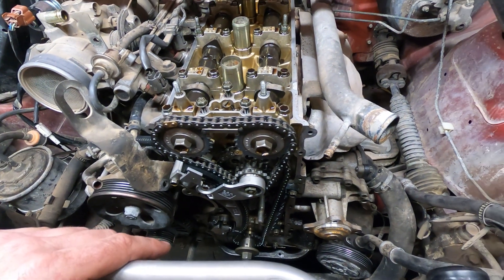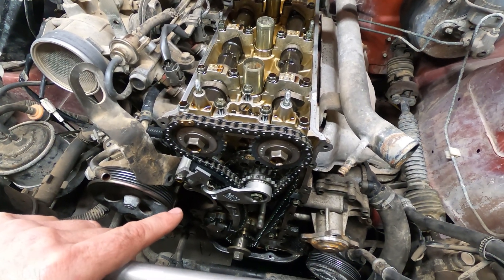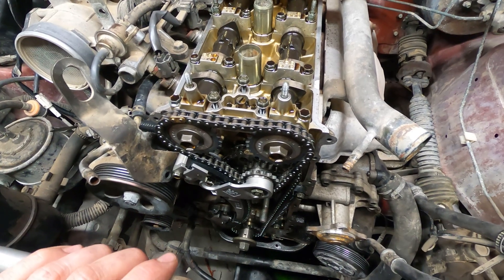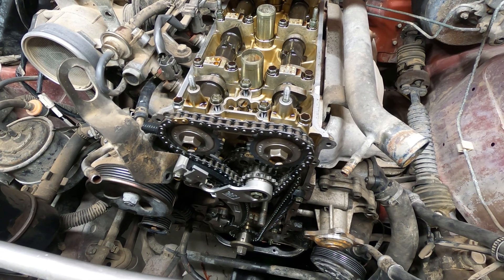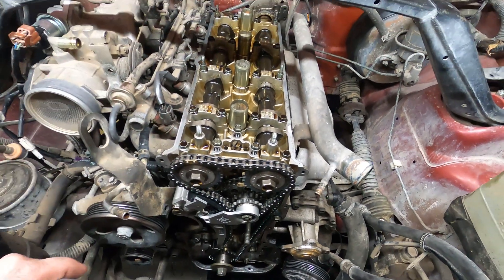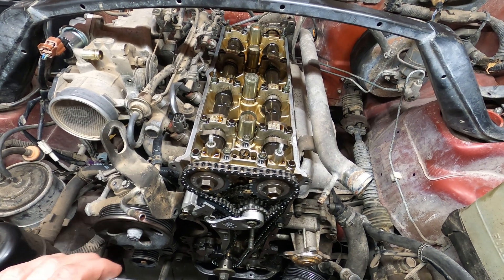I got really excited about having both chains on and went ahead and turned over the engine twice, which is what you're supposed to do after getting both chains on. I torqued all the bolts — I'll post the torque specs in the description so you have those. They are in the Haynes manual, but I'll post them so they're easy to find. I turned the engine over twice and everything lined up. The bottom tensioner is able to work now because I've got that spacer on the nut. I'll get the timing cover back on, all the accessories, and the valve cover. Also, this is a great time to change your oil — make sure you change your oil when you do the timing chain.